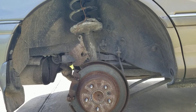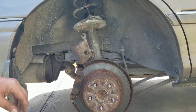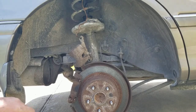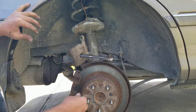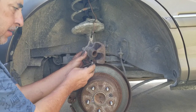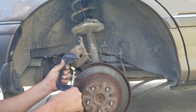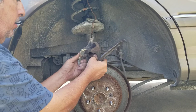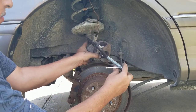You gotta try to make sure you can see everything. I'm out here in the sun so I can't see exactly what I'm doing. So I'm moving right now to get the tool. Remember I said you're gonna have to push this caliper back. You have to push that back to be able to get this back on there with a new rotor. I'm gonna put this right there and put a c-clamp right there. You're gonna need a c-clamp or something to push it back with. So I'll put this in front of that piston. Put the c-clamp on - just push the piston in and it won't screw too much.